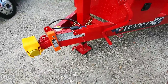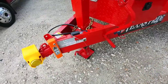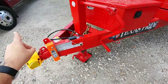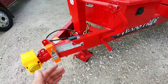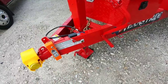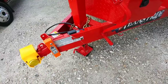A big one and one of the main reasons I love this trailer: Texas Pride took their 20,000-pound specced trailer and were able to derate it on the sticker to 12,000 pounds, which gives me the ability to pair it to my F450 — which has a gross vehicle weight rating of 14,000 pounds — plus 12,000 for the trailer, putting me at 26,000 pounds combined. So if I ever have to use this for a business, I don't have to worry about going beyond 26,000 pounds, which would require a CDL if I'm going to be making any type of profit or money.